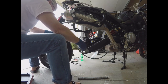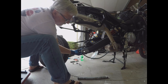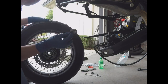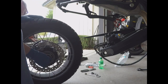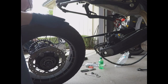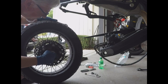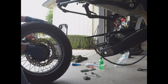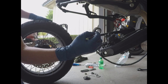We'll get the tire out of the way — maybe I can set it back on that slot so that it holds itself nicely. I think that will stay. There is this spacer here which slides into the edge of the wheel. That's the only other dangling item. On the other side there's a similar grease cap that just comes off with no attachment. Take those off and set them on their respective sides so they don't get lost. This one actually has a lip — the lip goes on the outside of the wheel as it goes in.